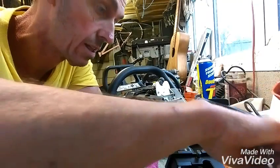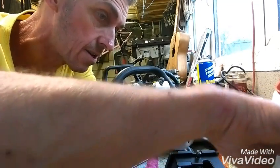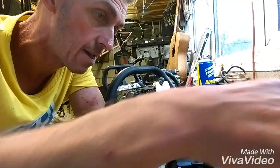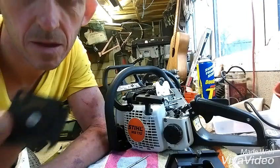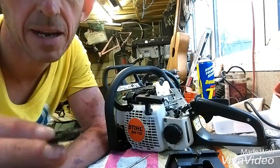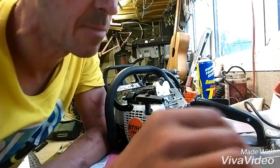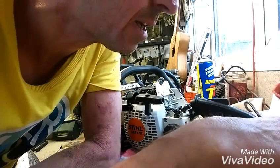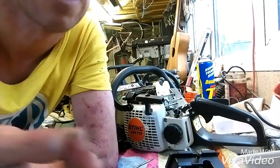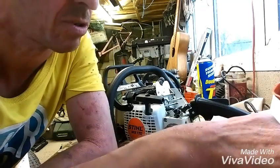Inside them there's some real little - one's called a measuring valve I think - real delicate little thing here. You can see on one side of it, it's full of sawdust and all sorts in it. You can see sawdust there. Now bear in mind, that is pumping fuel through real tiny little holes. I'm going to show you the jet - you can make it out there, that's how small the jet is. Now if there's a lot of sawdust, it's not going to work.